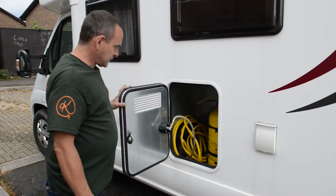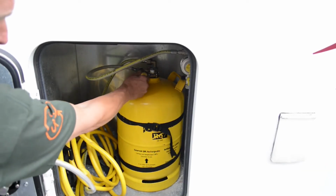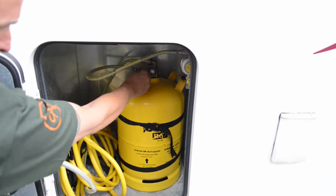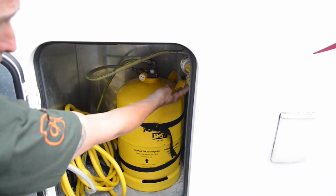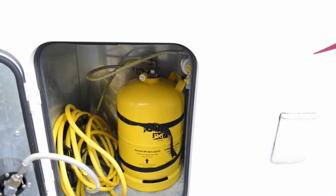We also in here have the 6-metre hose to fill your water up, which I'll show you in a minute. So this is the gas on-off switch. So anti-clockwise to on, and before you drive away, again, you need to make sure that is closed by turning that off. And I'll normally flick this little lever as well, quarter turn lever, flick that in the off position as well.